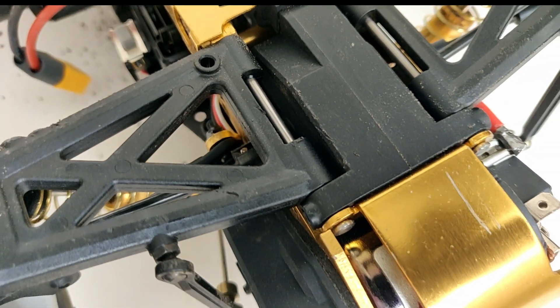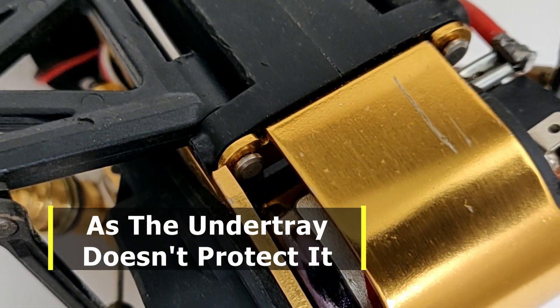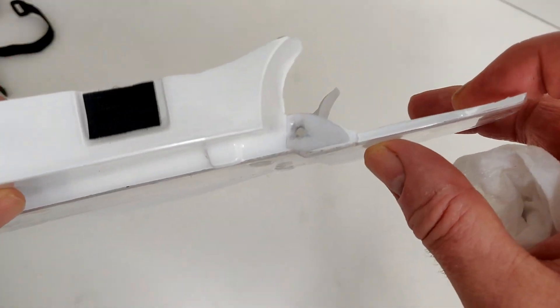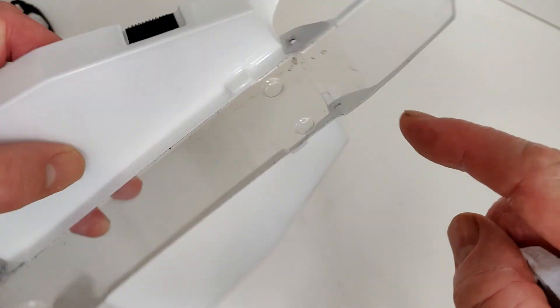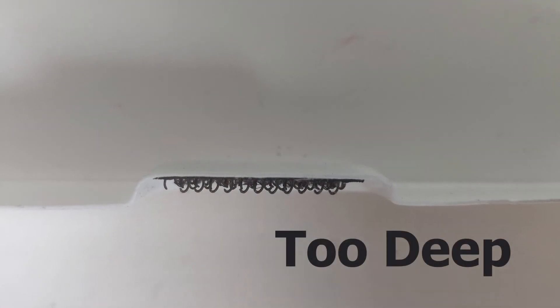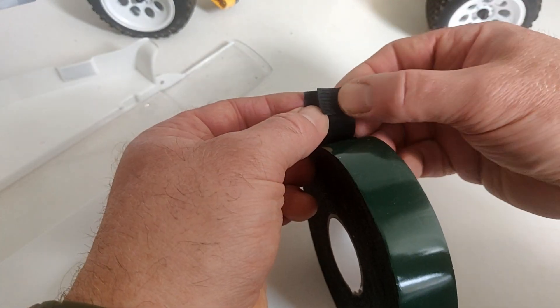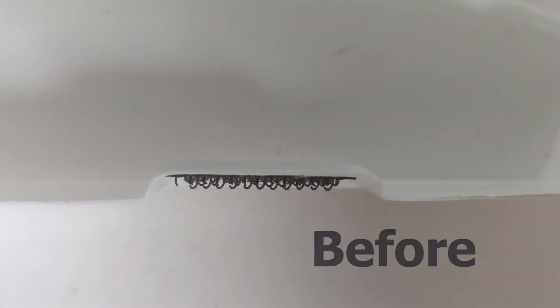Perhaps it would be a good idea to put some tape over the gold before installing the under tray. I did plan to put tape on the motor guard but with all those delays and limited time I just ended up forgetting, as I was so desperate to get out and drive it. Here you can see the crack that happened when I drove into that tree root. I'll fix it the same way as the other repairs. I should also point out that the recess where you put the velcro is too deep, so I'm going to use some number plate tape underneath the velcro to lift it to the right height so it works much better.